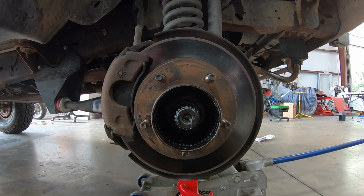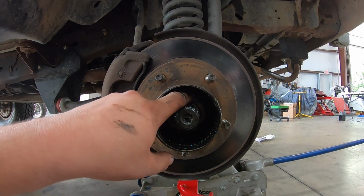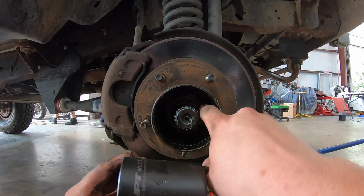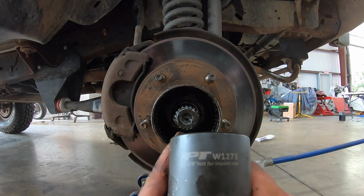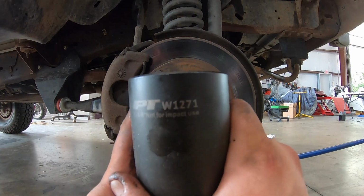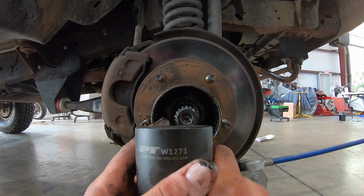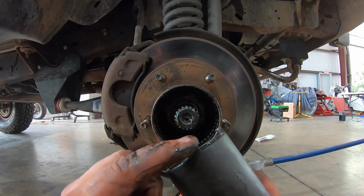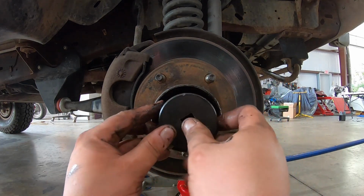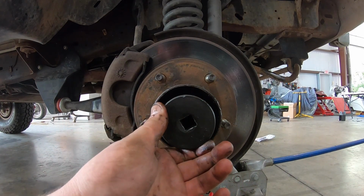Now, you do need a special tool to get the axle nut off. This one is the high torque one. I got this at O'Reilly's, not sponsored or anything, but the part number is PTW1271. Don't use an impact on it, and it just has these little channels right here that fit right in, just like that, and then you break it loose. So I'm gonna do that real quick.